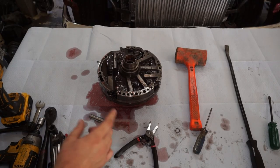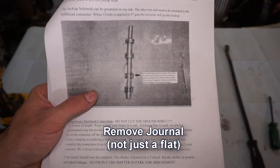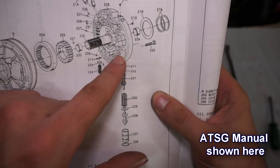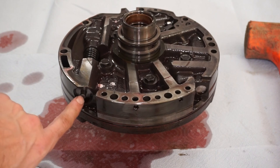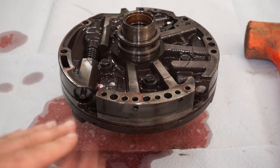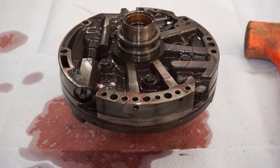Next I'm going to take the pump apart, but I also have to take out the torque converter valve. There's a step in the instructions that wants you to grind a flat into this journal on the TCC valve — that valve on the drawing is number 223, the TCC valve. It's on the opposite side of the pump as the boost valve. The boost valve is the one that has this little pin on it and this is the TCC valve over here — it just has a little snap ring and it should come out. I'm going to separate the pump because I want to make sure we have the line-to-lube drilling done, and we're also going to be putting the pump separator plate in here.